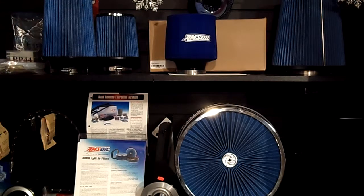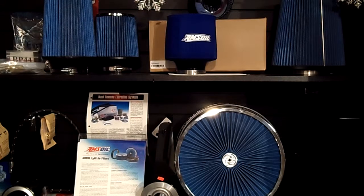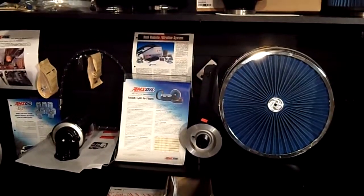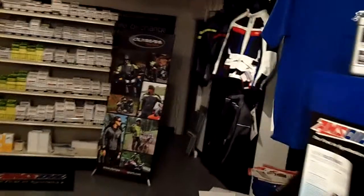Oh, by the way, the flow of these air filters, there's nothing compromised. The original initial design was made for the Abrams M1 tank to keep sand getting into the engine, and they use vibration to clean them. So if you read our material online, just go to Oil Ordering Online, you'll see that they do filter nicely down to 2 micron. And they also have just the same capacity, if not more, but it's still going to provide more air volume than the engine can handle anyway. So there's no compromise there. And by the way, if you go online, you just look up the EAAU air filter, Echo Alpha Alpha Uniform.